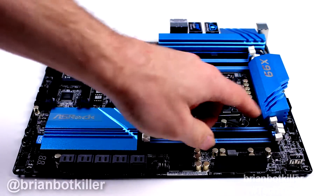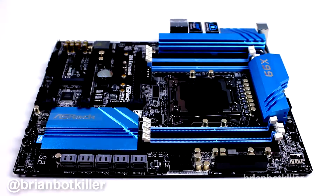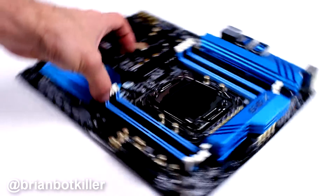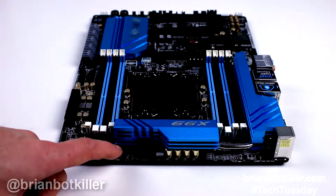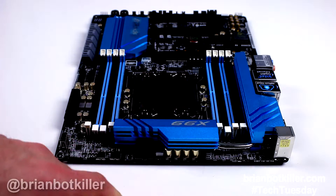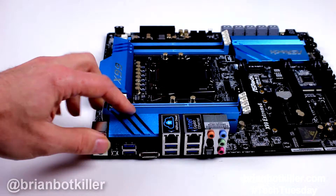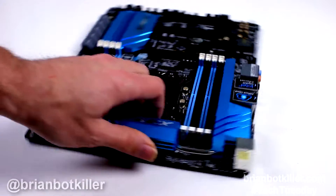Moving on up to the North Bridge — relatively large heatsink on here, so make sure you're using a CPU cooler that will not run into issues with that. Most shouldn't, but it's just worth taking into consideration. Eight RAM slots, as I was talking about, supports DDR4 quad-channel RAM up to 128GB. Way up on the North Bridge you'll find more fan connectors — CPU fan connector and then a second CPU fan connector, good for water-cooled systems. 12-volt rails right here, and nice heat piping between the heatsink on the west side of the board and the heatsink on the north side.